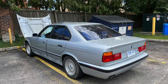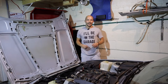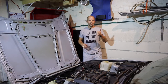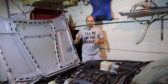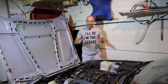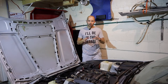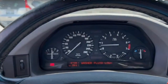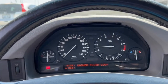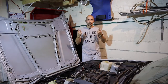What are we talking about today? Electrical gremlins. I took this thing for the first drive — that ended horribly. The water pump pulley disintegrated on me. We got that fixed. We went for the first drive, part 2, and some electrical gremlins started to come up. First issue: when the engine was hot, the engine wouldn't crank — not a hot no-start, just nothing. I suspect something with the starter relay. However, being a 1995 E34, the last year of production, I cannot find a single schematic for where the starter relays are. The second gremlin was a check engine light that appeared in hot traffic and went away once I started driving. And the third gremlin — the rear windows just stopped working. So with all that said, let's get to work.